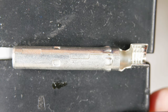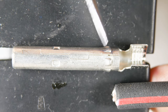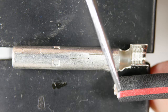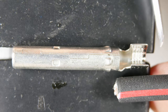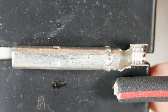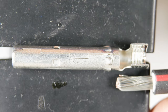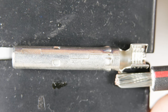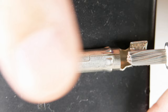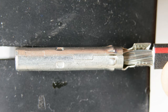The next step is to prep the wire to solder in here. We want the wire just long enough that it is short of those little bumps — no solder near those bumps inside or outside. So we start with the wire at about this position, cut it off right at the end of the plug, insert it, fold the tabs over, and solder it. When we solder, we want this plug pointing upwards — sloped so that any solder runs back this direction and not out into the critical part. I've got the wire trimmed and it will go right in there avoiding the bumps on the ferrule.